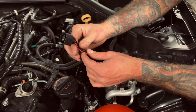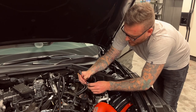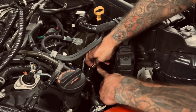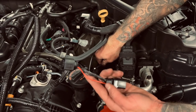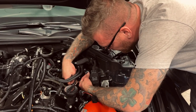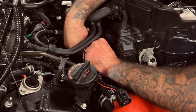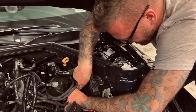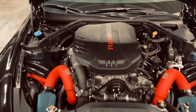These are the connectors I've been telling you about — they make the PNP and the EWG. I'm not going to do the EWG fuel connectors today. If you're installing the JB4, I would definitely recommend getting these PNP adapters. Right here is where your sleeve is — you can see where I punctured in with the posi tap. What this allows you to do is not have to puncture a hole in your factory O2 harness — you just puncture the hole in this connector. If your Kia Stinger has already been punctured, there's a sleeve that slides over it, but I'd highly recommend running some electrical tape over that hole. With these adapters all I gotta do is posi tap, click it back in, and I'm done — it helps mitigate dust and moisture getting into that punctured hole. JB4 is installed, velcros back on, PNP connectors are installed, intakes are in.